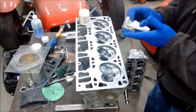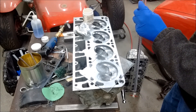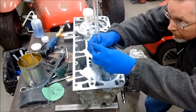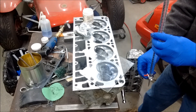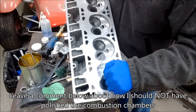Theoretically, polishing the combustion chambers reduces all of the hot spots or potential sources for pre-ignition and detonation. It can also keep more of the heat in combustion and into the exhaust and hopefully increase the spool of the turbo a bit better. But mainly I just did it to avoid detonation because I'm using cast pistons with an LS, and I know the LS motors can handle a ton.